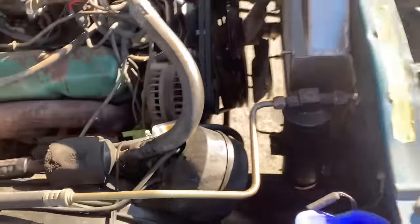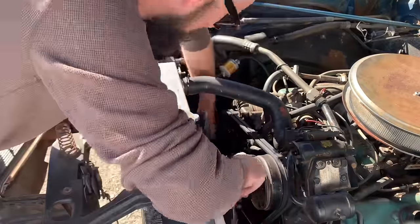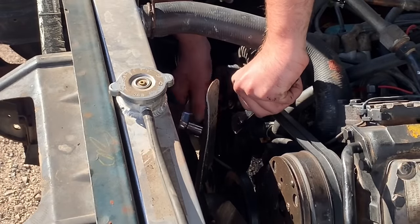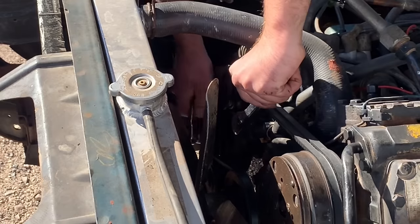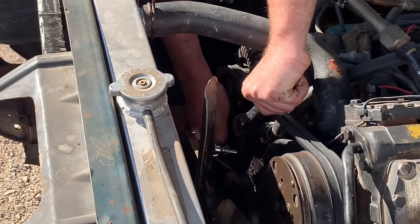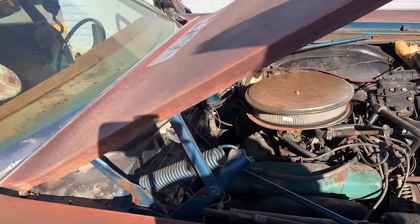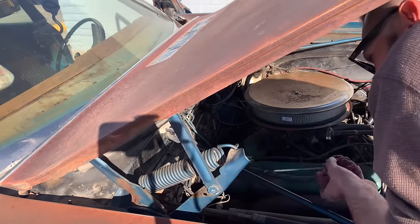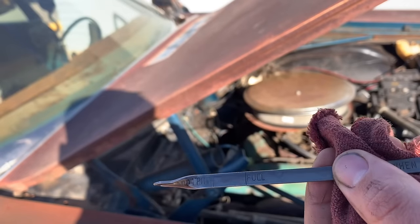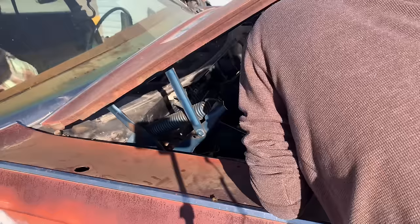There's a NAPA like 0.3 miles away with a fan belt. On these 383s they actually have a half-inch drive square hole where you can put a ratchet in — that's why I've got two ratchets: one holding tension on the belt and the other tightening the 9/16 bolts that hold the idler pulley in place to keep the belt tight. I also want to check the tranny fluid — the tranny pan has been dripping a little, the tranny cooler has a little drip too, so we're a little bit low. Yeah, we're good.